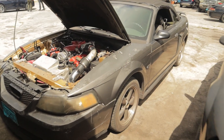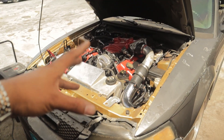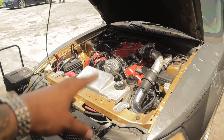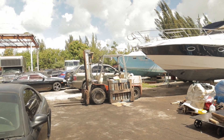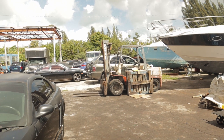Let me show you guys an example. I'm not going to show it on my Mustang GT because I've already identified there's going to be an issue with that — it doesn't want to charge unless you rev the motor. So we're going to do it on my 2006 Acura MDX. Pop the hood — like I said, you put the positive lead on the alternator, negative lead on the battery, and then you should get a proper reading to test for AC voltage.